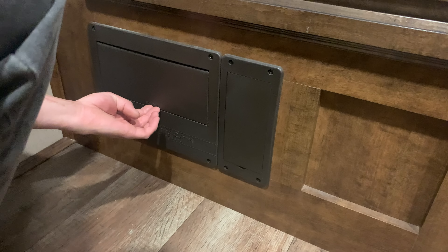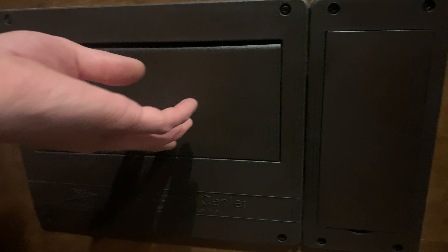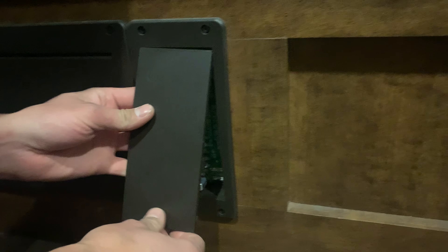Just right down here you do have your breaker panel and fuse panel. You just have to push that in and it'll flip up, giving you access to all your breakers. Whenever a breaker trips it's going to sit in the middle, so you just have to turn it off and then back on again to reset it. Then you just have your fuses right next to that — pull on it to open and it gives you access to all those fuses. Whenever a fuse blows, that's where you're going to find it. That's going to be it for this unit — if you have any other questions, feel free to give us a call.